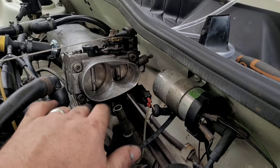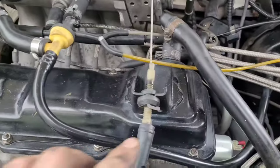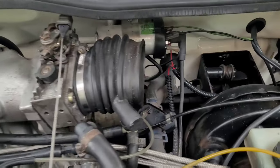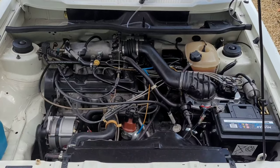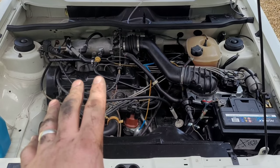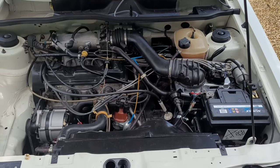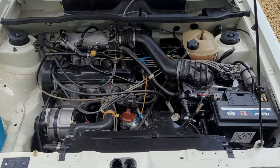She's on the car — bolted on, connectors on, idle screw set, throttle linkage on. We have a nice factory-straight throttle cable line opening both butterflies perfectly. One thing to make sure is that the jubilee clips on the intake pipe don't foul at full throttle. Once that's done, you need to adjust your CO, idle, and ignition timing to get everything spot on and running sweet.